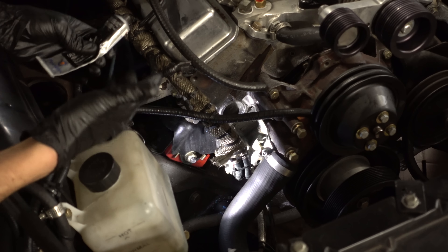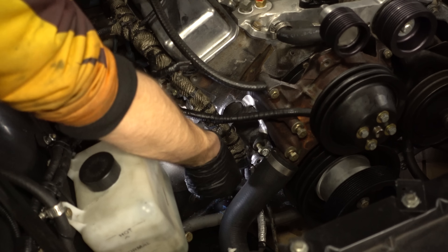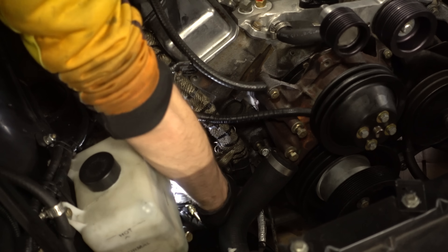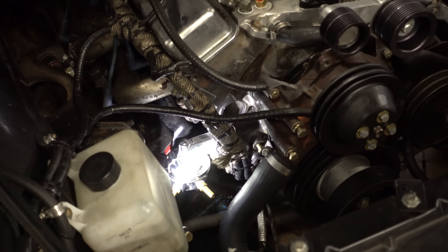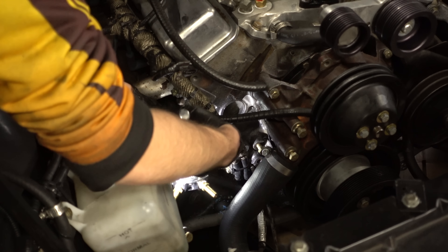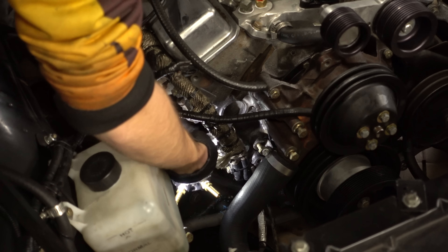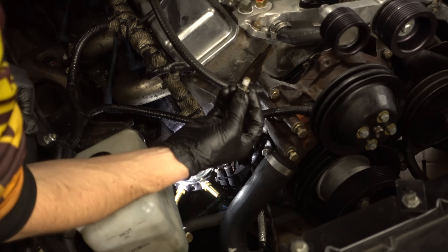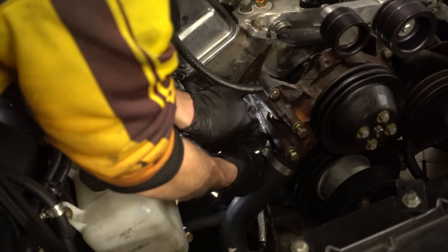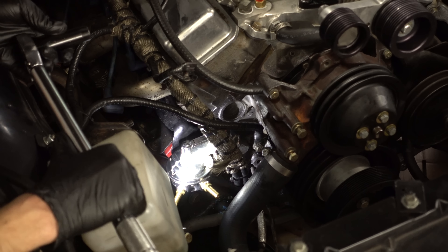This is just a splash oil seal — it's not all that important, but I'm still going to put a little bit of RTV around it for insurance. The fuel pump bolts have lock washers on them and I put just a bit of engine oil on the threads. Now it's fighting the spring pressure on the pump, so I'll snug down both bolts and try to be even about it. We'll let that sit for a little while so the RTV can cure. In the meantime, I'll remove that push rod bolt and reinstall the old bolt with just a touch of thread sealer on it. Since I was using this as a ground, we'll hook that cable on it as well. The torque specs for the fuel pump bolts said 20 to 30 foot-pounds, so I'll go ahead and do 25 for these two.